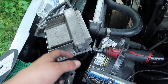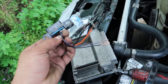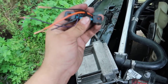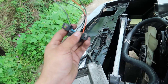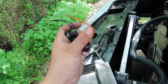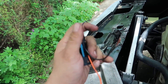I have the port here. I went ahead and pulled the computer out because the most important thing to run this OBD port is the Class 2 serial data line — that is the connection between the PCM and the OBD port. So the four main wires you need: purple is your data, you've got two black wires which are both grounds, and your orange is constant power. That's all it is to it.